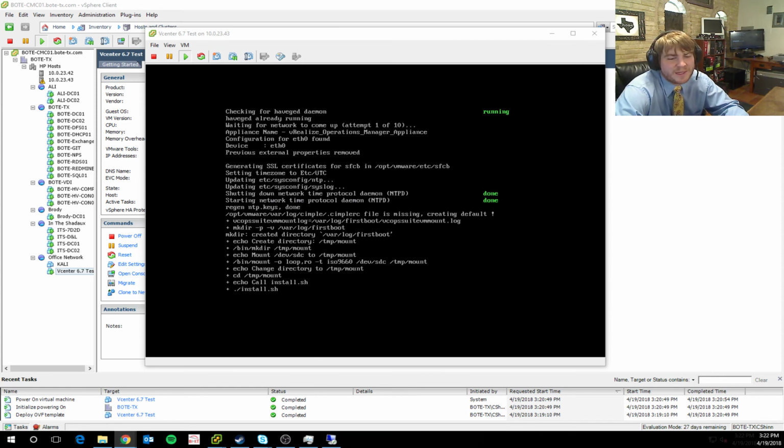I've been monitoring pfSense this whole time too, because since it runs as a VM, I like to see its CPU usage. It's been sticking at about 9 to 16%, somewhere in there. It's not too bad, I feel, for everything I've got going on here, along with live streaming at a really high bit rate so that I can get 1080p up to YouTube properly, with no lag and no issues.